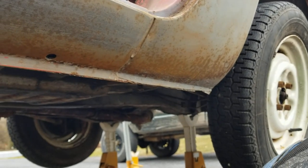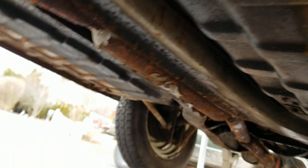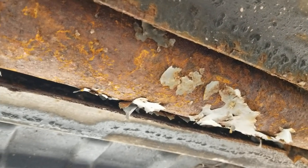I'm on the ground right now — this is very uncomfortable. I just looked at all the rust underneath and there is pretty much no rust at all that concerns me. The exhaust might need redone sometime, but everything's solid, no holes through it. Even the fuel lines and brake lines look solid. The floorboards themselves are really clean. The rocker was pretty rusty — just surface rust — but it's pretty much sanded down by now.